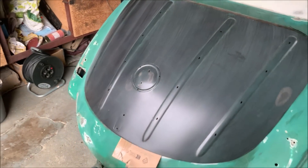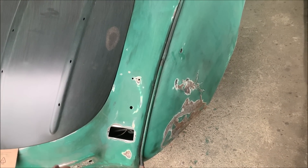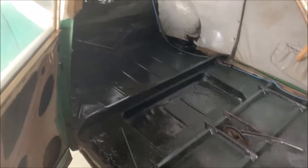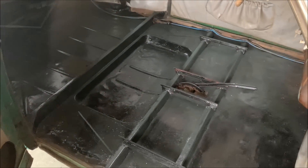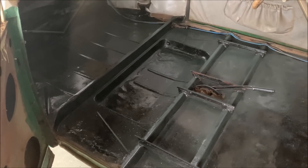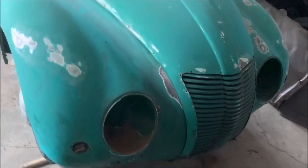I'm very happy with the result so far — it looks very nice. It's not matte black, it's not shiny black; it's called Seidenmatte, which is something in between, and I think it fits very well and will look great with some chrome. I removed the bumper and improved this area a little bit — you may remember from the last videos there was a big dent, and I could hammer that out by quite a bit. Inside the car is black now, also a bit dusty from all the rubbing down, but this is the rust protection paint — it reacts with the rust underneath and creates a stable connection so it doesn't rust any further.